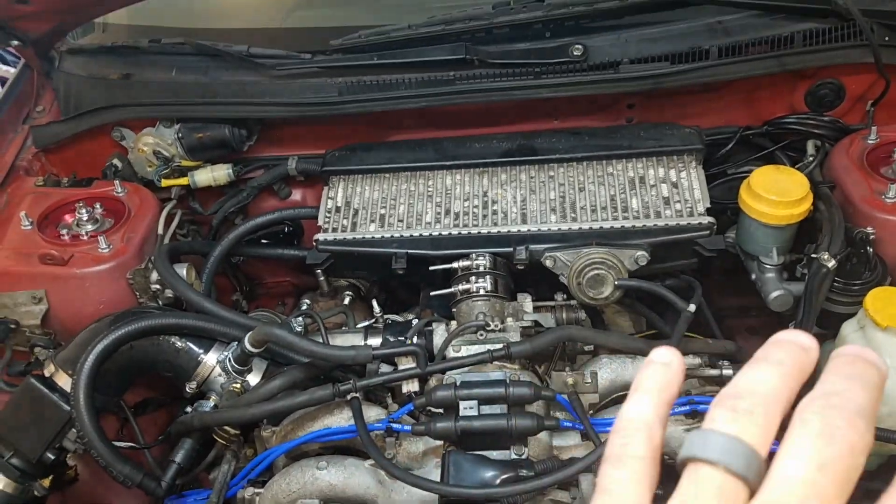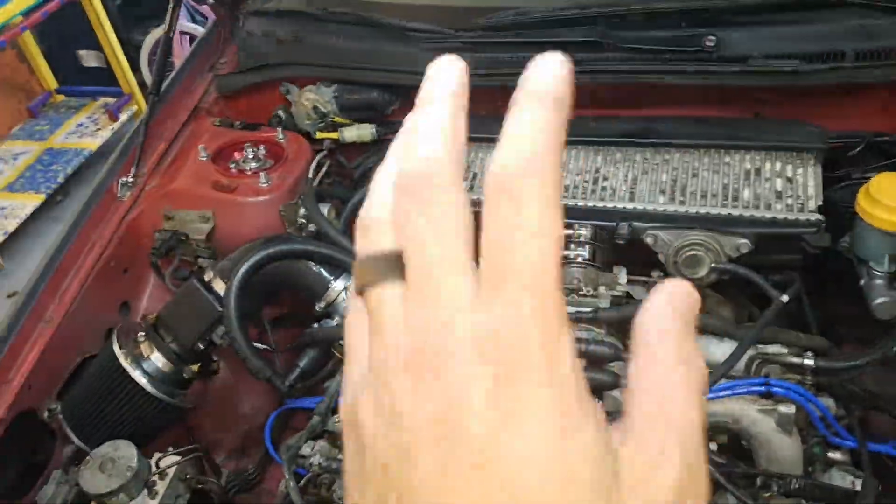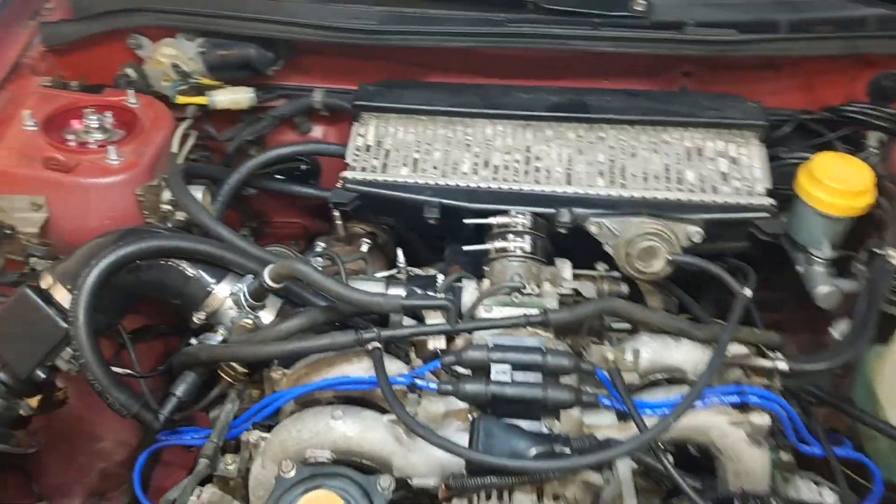The other issue I ran into: I got the car up and running after I changed the plugs out and installed the intake. Everything was running great, but when I was idling it was kind of surging and running pretty rich. I knew probably there was a vacuum leak somewhere or some form of leak. I had this same problem in my previous build, and it took me forever to figure it out that time. So having idling issues — the car's running great otherwise, but just kind of a surging idle, kind of just jumping up in the RPMs and stalling.